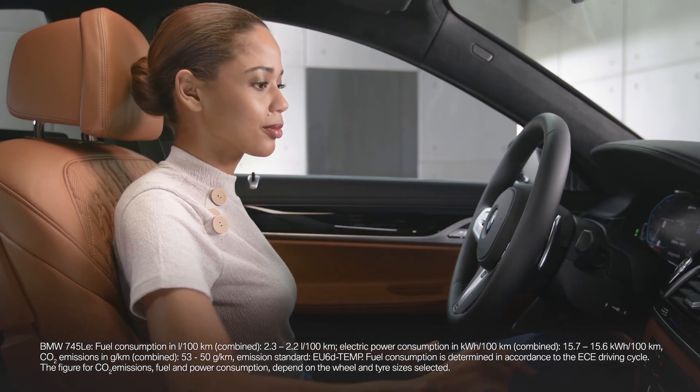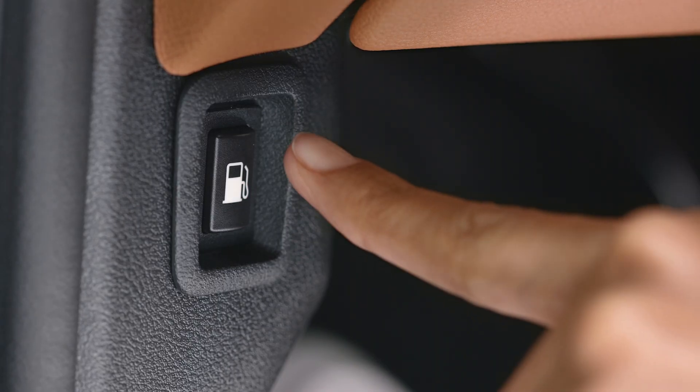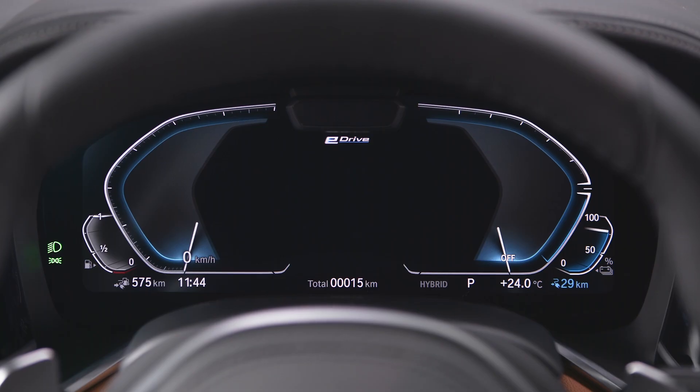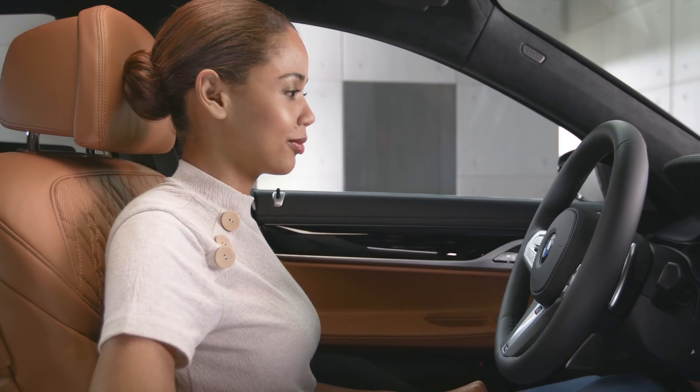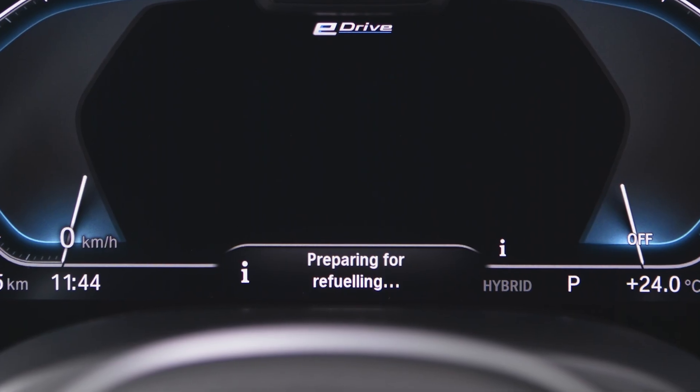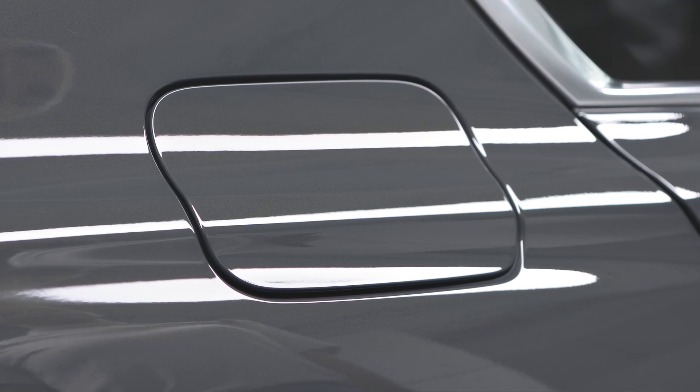Make sure to switch off the drive-ready state of the vehicle. Press the button in the driver's door area to start aerating. You can see the tank aeration status in the instrument cluster. When the tank aeration has finished, a message is displayed in the instrument cluster and the fuel filler flap is unlocked for opening.